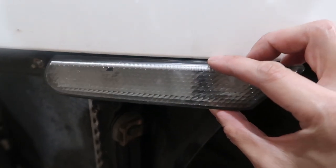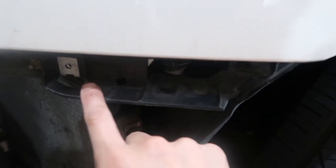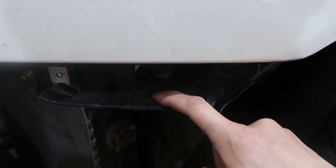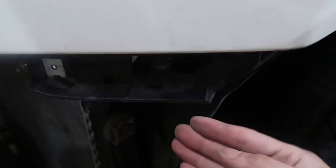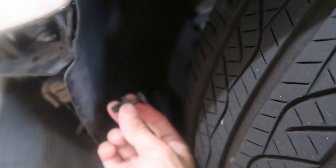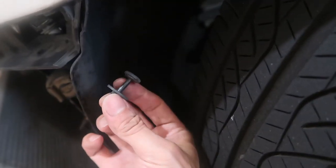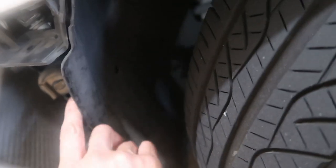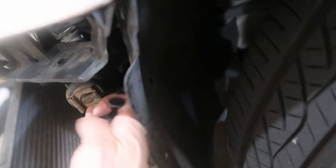Your front bumper is captured by various screws. You remove this piece — there's one screw right here and one screw right here, but you can't access them because the front bumper is over here. You've got to sneak in behind this little flap. This little flap is held in by a couple of these little screw clips — you've got to pop them open and take them out, just enough to remove this so you can reach in here.